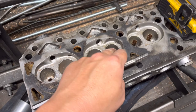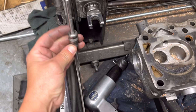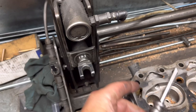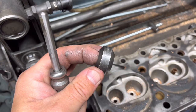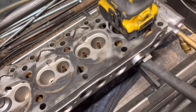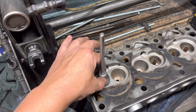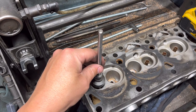Obviously, 5/16th sleeve, 5/16th kit. We put that over the end of there, and that sits in the slot — it's air operated. When you turn the air on, it pushes that down into the seat. You find the right sort of insert to fit the seat — you've got one side 30 degree, one side 45. If it's a 45 degree seat, it goes in like that. That just ensures the cutter is basically staying true to the existing seat, so you're not miles off.